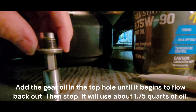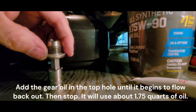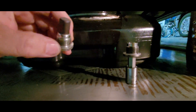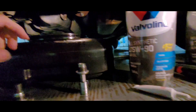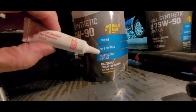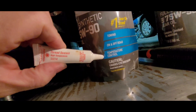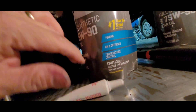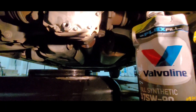It's probably a good idea to replace the little washer gaskets — each plug has one. I didn't realize that before I started the job, so I'm going to reuse mine. My truck actually specs out to have thread sealant, so since I have some left over from doing the same job on my pickup truck, I'm just going to use a little thread sealant on there, and I'm sure we'll be okay.